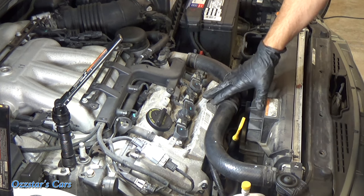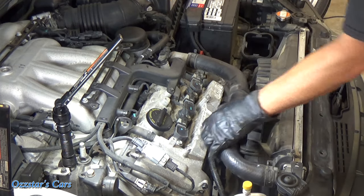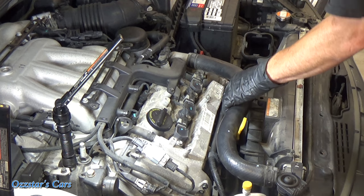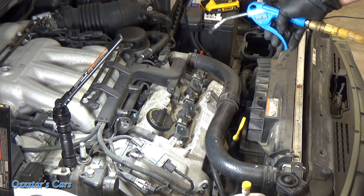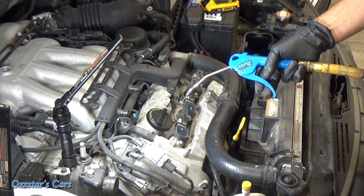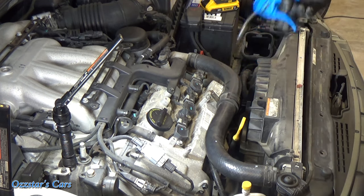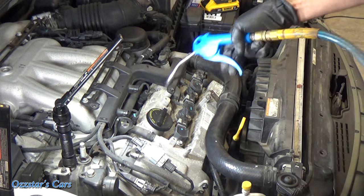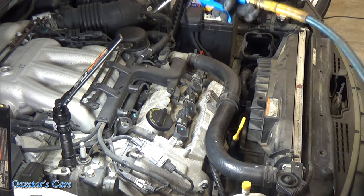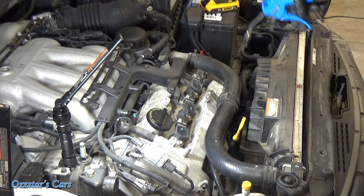It's possible to bungee this hose back and not have to disconnect it. Before you remove your valve cover, I suggest you air it off with a compressed air gun — if not, a shop vac might help. You want to get all the loose debris off; we don't want any grit going down into the engine. Once the valve cover comes off, everything will be exposed internally. Give the engine a good blast and get all the nooks and crannies.